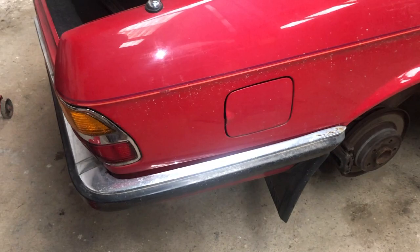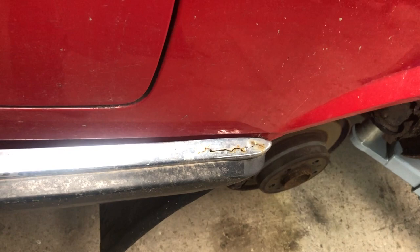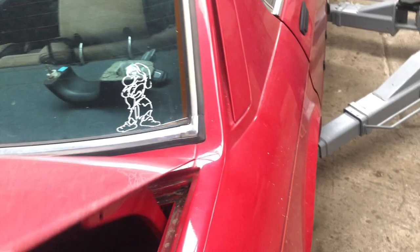Not really planning to cover things like trim and chrome in this video, but here's a fairly good example of rusty chrome on a bumper. You can see it's rusting through — they tend to rot out from the bottom first, so if it's dry or you get the opportunity to get under it, you can make a better assessment of the chrome.